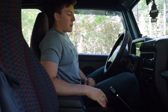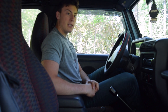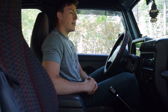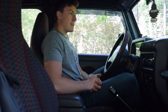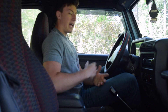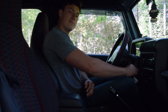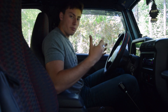A major issue I found with this Jeep when I went to buy it was the guy said he had to jumpstart it. So when I went to look at it, the Jeep was running, and when I took it on the test drive he simply said don't stall it — it might not start again. You'd think weak battery, maybe something like that. I was on my best manual driving behavior, didn't stall it, purchased it. When I stopped at the store on the ride home and tried to start it again, it didn't start. After pop-starting and getting it home, I dug into the issues. It could be the starter, something electrical with the clutch safety switch. But I lucked out — it was just the starter. Eighty, a hundred bucks, threw in the starter myself. Started right up, and then I had a cheap running, driving, and starting Jeep Wrangler on my hands.